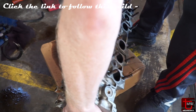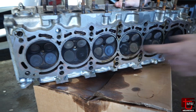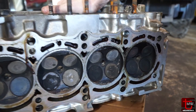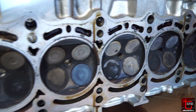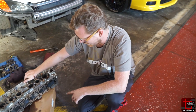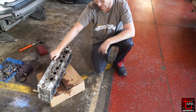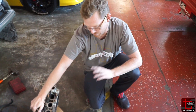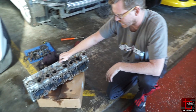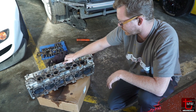If you look at the underside here — I said one and six were good — you can see the coloration is nice and uniform on one and six. And then the four that didn't have good compression are kind of ugly and random. Leak down was like 40% out of a couple of these — definitely in need of a valve job. It's going to get decked, of course, to check for flatness because I know it's been overheated. New head gasket. It's got ARP studs already — we'll need to check those and make sure they're usable again.